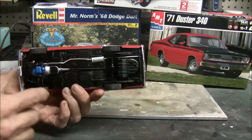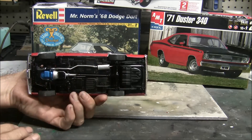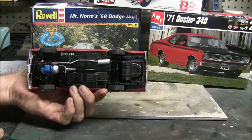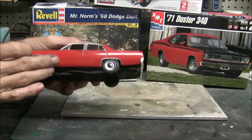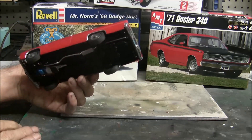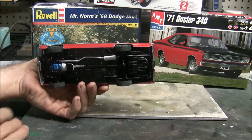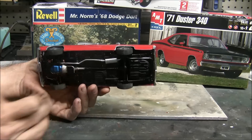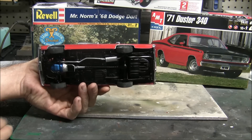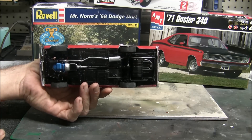On the bottom of the car, we used the exhaust system from the '64 Dodge because it was set up with a single exhaust for the slant six. I reshaped the pipe a bit, bending it here and there along with the muffler, and it laid down great — it's not hanging down from the side profile at all. We've got the single tailpipe coming out at the rear. Everything on the chassis is from the '71 Duster and it all lined up really well.